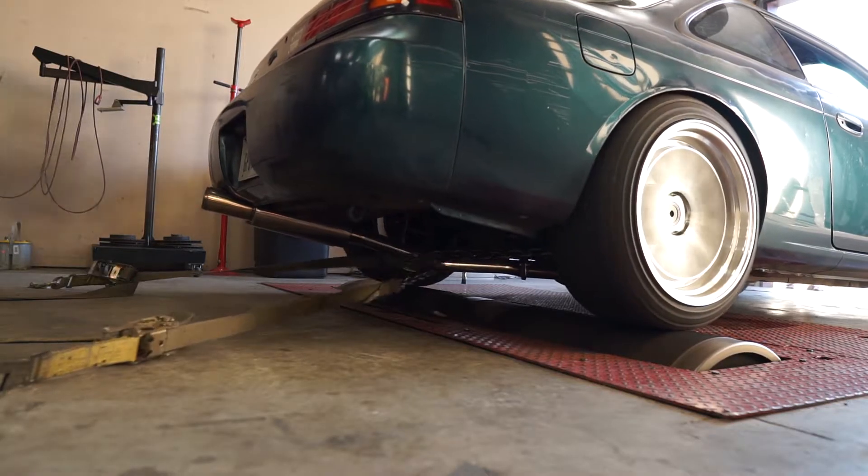I was going to end the video except it's been like a day or two and I haven't finished the video anyway. I've had a chance to get the turbo off the car, and I have never actually seen a turbo blow up in this way before — not on just one random dyno pull. Basically on the dyno pull all we knew was the nut had come off and we didn't really know what happened. But if you look at the video, you can see towards the end of the pull all of a sudden just black fuel smoke coming out. It was making good boost and then the boost disappeared.